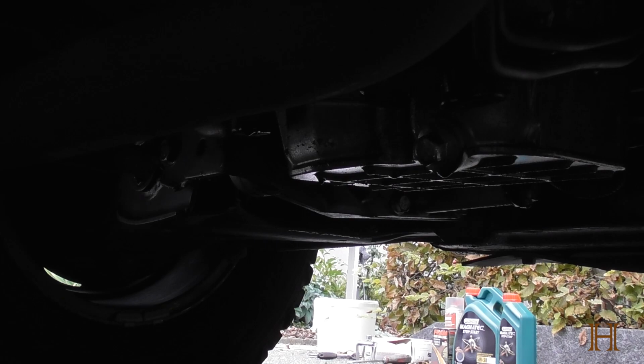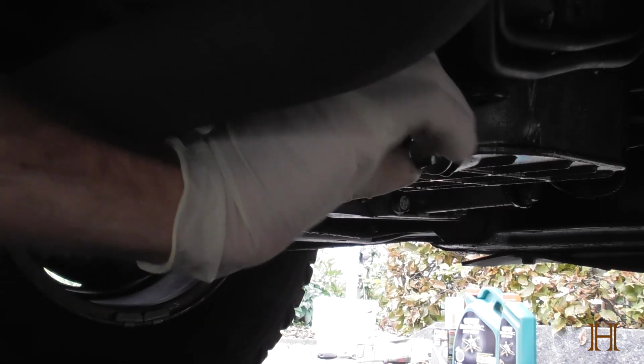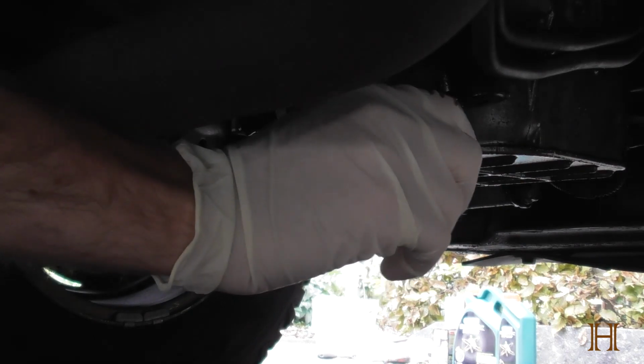Oil pan, catch container, whatever you want to call it. Put it in place, make sure it's lined up nicely, because you don't want to spill engine oil. Even though it comes from the earth, it's not good to just put it back in. Then start to unscrew it slowly. Keep slight pressure on the screw inward so it doesn't fall out on you.